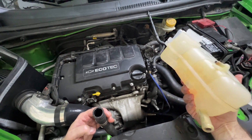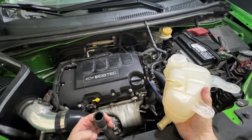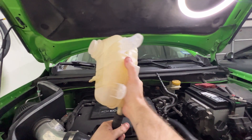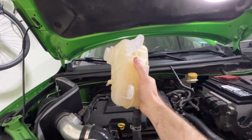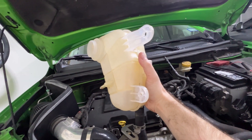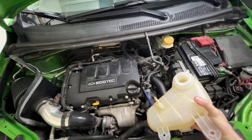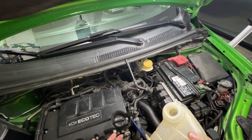I did this video not because mine needed replacing, but because I wanted to share it with y'all. Now we go with the replacement. In reverse order, reattach that coolant reservoir to the hose, give it some twist, and then use your channel locks to squeeze and slide the band clamp back up where it belongs. Now remember, you're going to want to reattach this while it's still elevated so nothing leaks out.